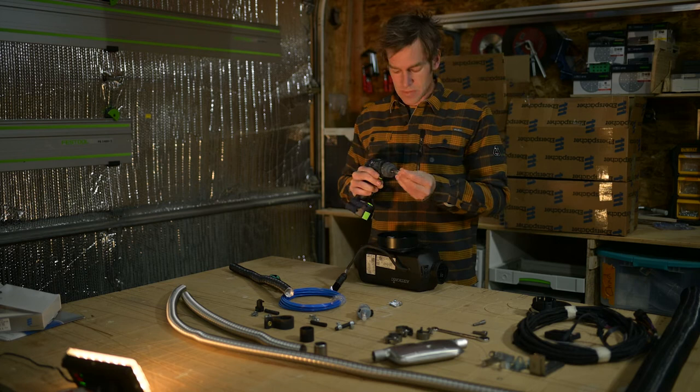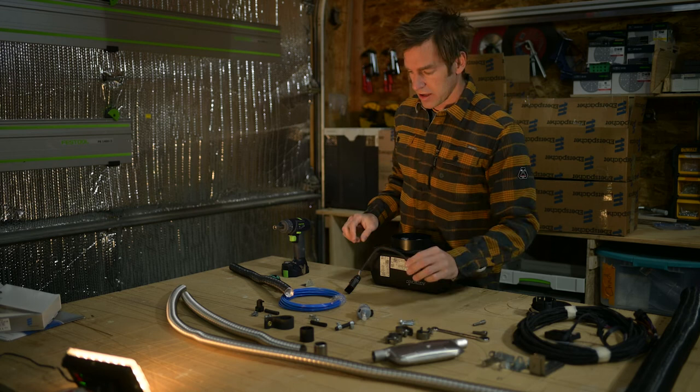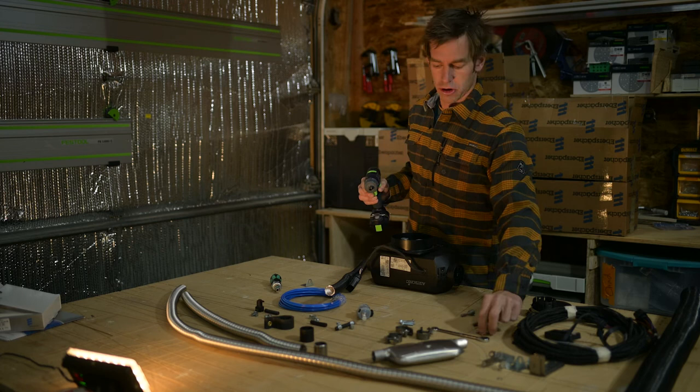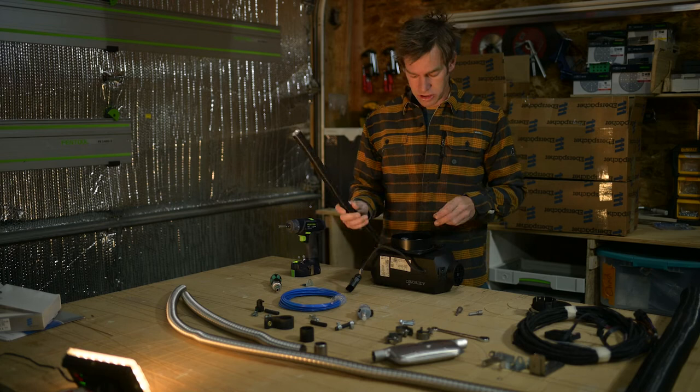So now we're seating that gasket plate onto this metal plate, and then we'll just connect everything to here. So let's just quickly go through here. I've got my air in tube. There's a little arrow there that says air in. The air in tube, think of it as your cold air. So your cold air is gonna be next to your fuel line in. It makes sense because your fuel line, you want next to the cold part of the exhaust and not the hot part. So kind of easy to recognize all these things.